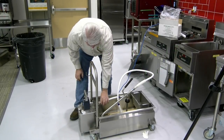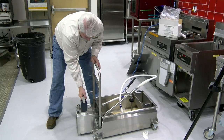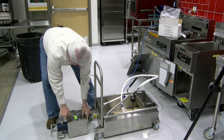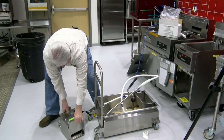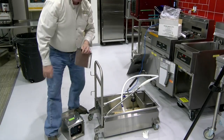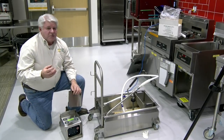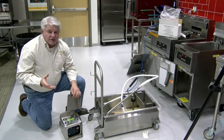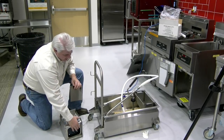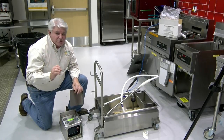Remove the intake hose and lay the machine and the motor down on its side. Remove this tray and you'll see a red button on the inside — that is the reset button. You need to let the motor cool down because it is a thermal reset. It usually takes a good aggressive push to make it connect.